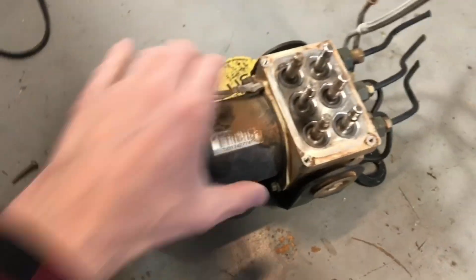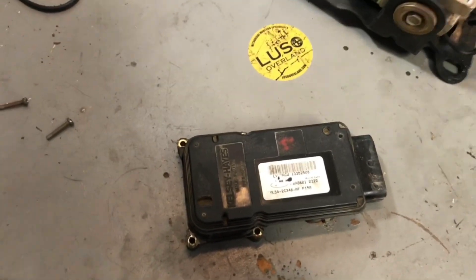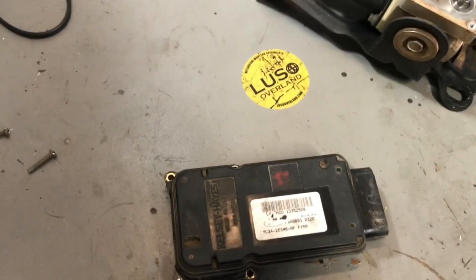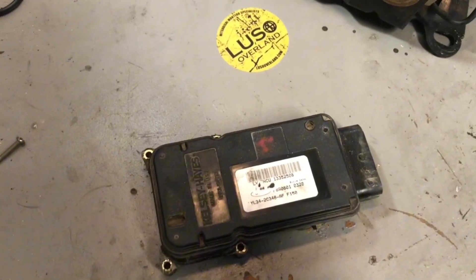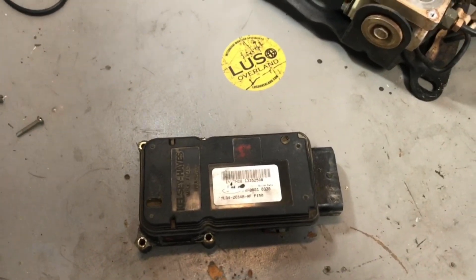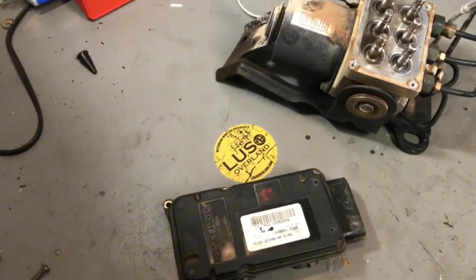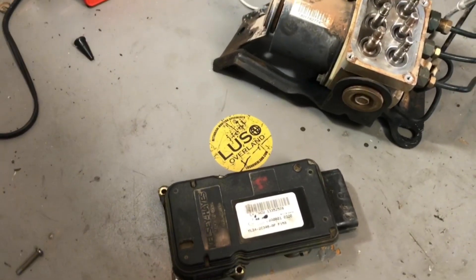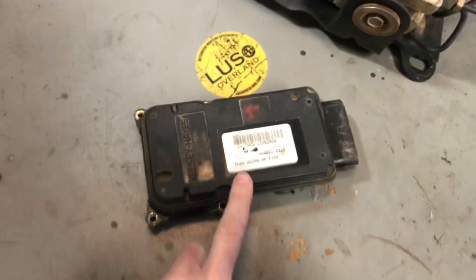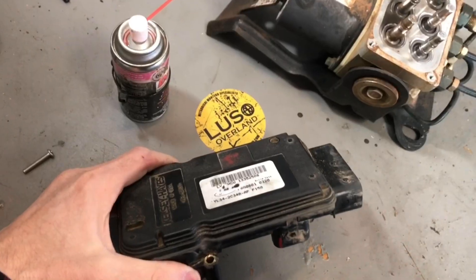One of the key things I want to let you guys know is that there are four different modules depending on what kind of F-150 you have. If you have the two-wheel drive, that's one part number. If you have the two-wheel drive heavy duty — like the 7,700 pound gross rating — that's another module. Then the same thing if you have four-wheel drive regular duty, and then four-wheel drive heavy duty. So when you go to the yard, find a donor vehicle — I would stick with F-150s, but I have heard of people using Expeditions without issue. It's got to match up with your vehicle. It'll actually say right on the sticker, like HD or heavy duty. The reason the previous owner got this out of a yard and it didn't work is because he bought the wrong one — this is a two-wheel drive module, so it won't work on my four-wheel drive truck.